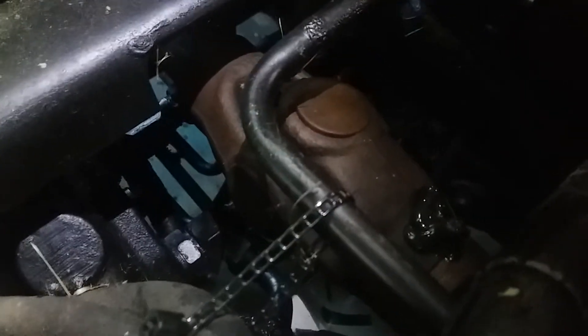That was a look at the driveshaft U-joint getting greased. Hopefully you guys don't ever have to replace your U-joints because they're a pain in the ass to get — well, not out of the tractor, just disconnected. You gotta hit those pins out to get them disconnected. These pins right here. They do make a tool for that that punches them out, but I don't have that tool, so I would have to just hit them out with a hammer, and that is very time consuming.